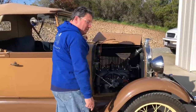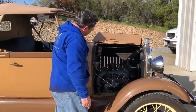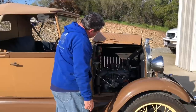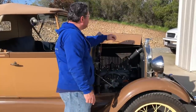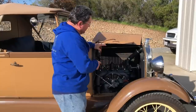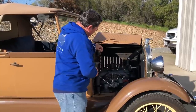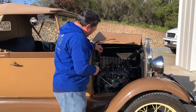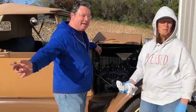We know that this actually works. We're going to save the fuel separator slash fuel filter. We'll probably put a little different filter in there. We're definitely replacing this copper tubing fuel line with the correct fuel line. Eventually we're going to change that carburetor for the correct Zenith, but not just yet. At least it still works. So now that the gas is all drained out, we can push it back inside and get out of this wind.